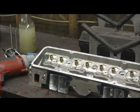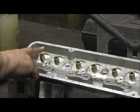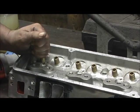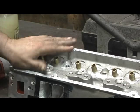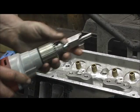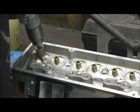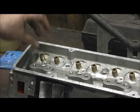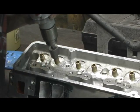While we're on the guides, I wanted to go over something real quick — let's zoom in. Although these heads say they're for a .530 guide, you would not believe how many of these are off as much as five to eight thousandths on the top. When you go to put your seals on there you'll tear up the seal because they're not exact. The China heads are worse about it than any of them. The Dart heads and the Brodix heads will put a better guide in the head — hats off to them for that. So I take a .530 PC cutter on a drill. See right there — I would have had a problem. I'd have tried to put the .530 seal on and it would not have been the right clearance and I would have probably torn up a seal and had it come back.